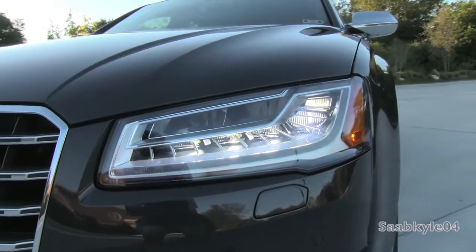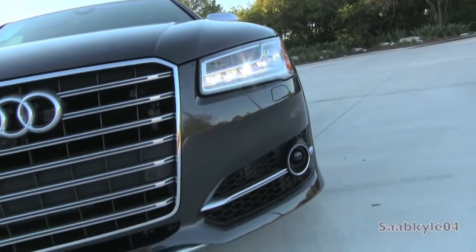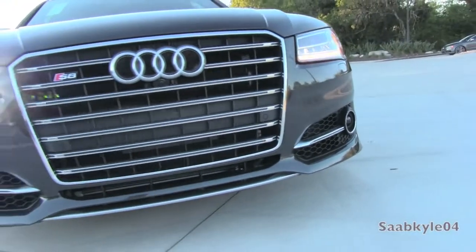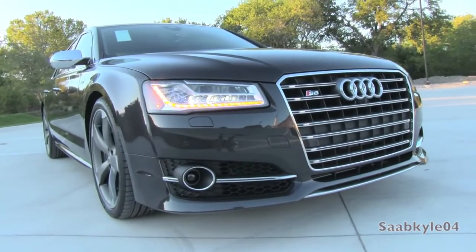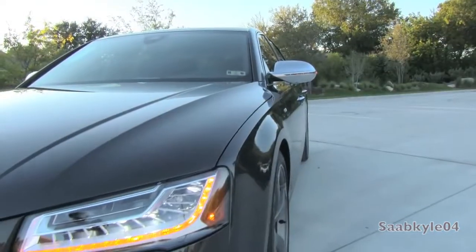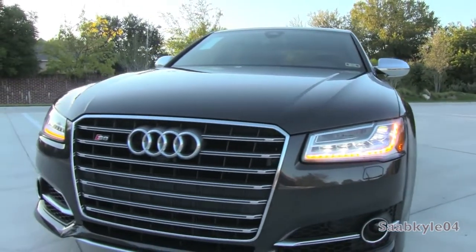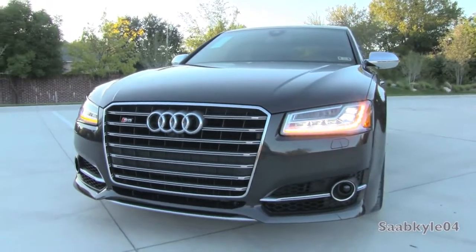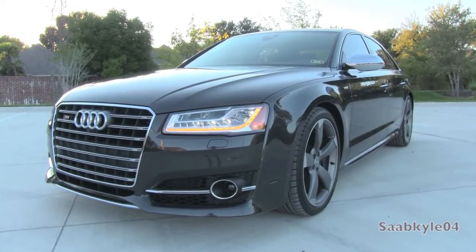With this, there's the option of Audi's new Matrix LED lighting system. Unfortunately, it's not available in North America at the moment due to government regulations that favor separate low and high beam functions. The adaptive matrix design contains 25 LEDs each and are continuously controlled by an intelligent cornering light system, giving it the ability to constantly adjust illumination intensity and direction based on steering, GPS signals, or cars approaching you.